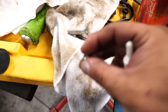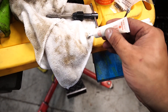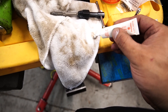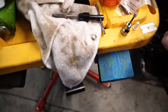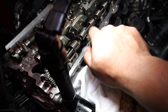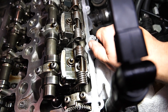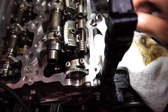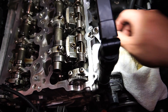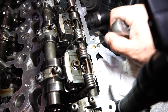Here's the plug. Take the thread sealant, cut off the top, and put a little drop toward the bottom — as you screw it in, it'll spread all over the threads. Go ahead and thread it in until it bottoms out, then give it a little extra turn to ensure it's sealed. This is an aluminum head so be careful not to over-torque — you can take a small ratchet and just give it a light hand turn to make sure it's snug. Now it's in there.